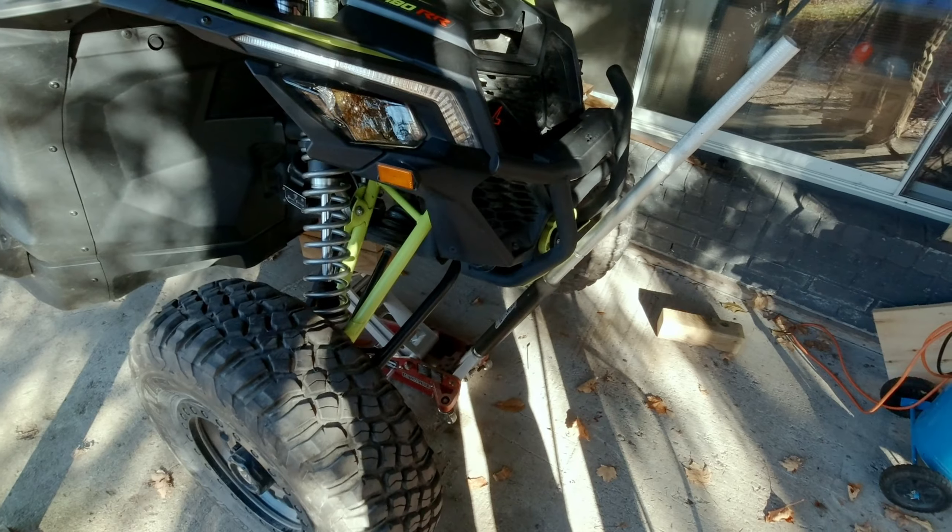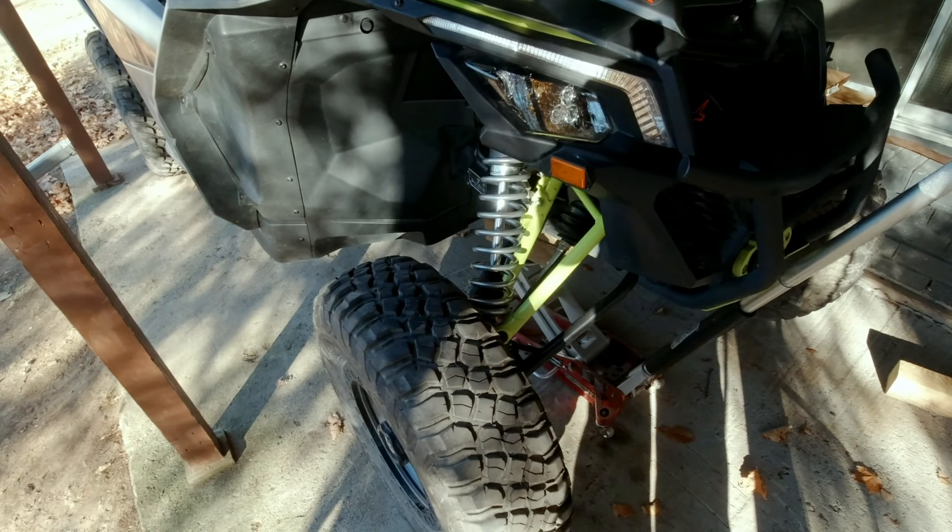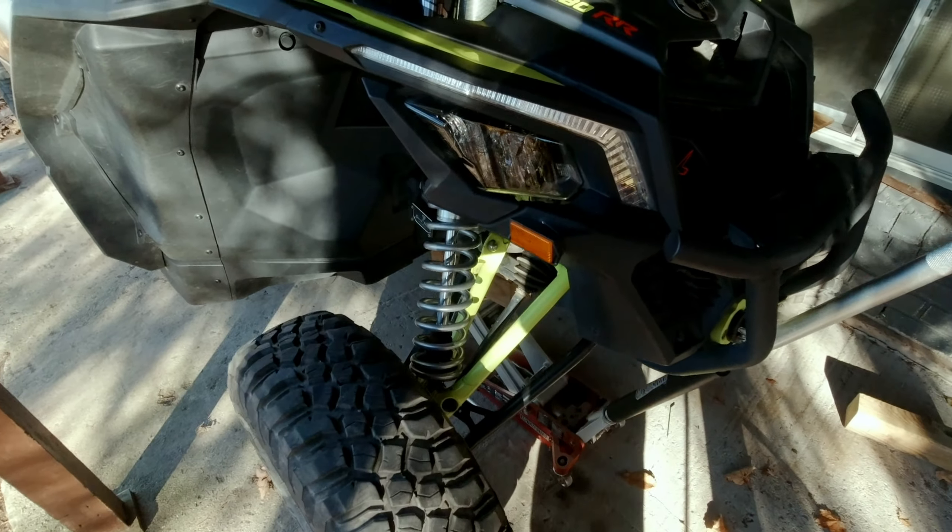I have the front of the car jacked up off the ground so all the weight is taken off the springs. I'll take a measurement for reference from the top of the shock body down to the top of the preload collar, then bust loose the top jam nut and get it out of the way. Then I'll screw the spring down about one inch, which should bring my ride height up about two inches. Obviously you want to do equal measurements and adjustments on each side to keep it equal.